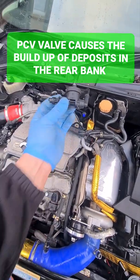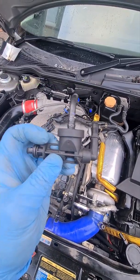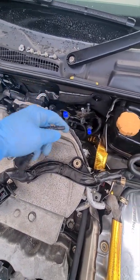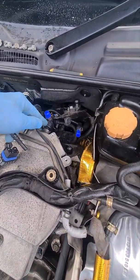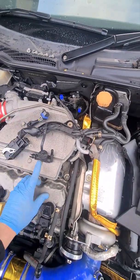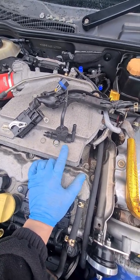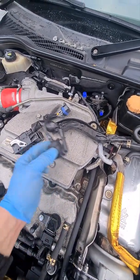The rear bank has a PCV valve which pushes into the rocker cover at the back of the engine — it's a bit hard to see down there. Inside is a little valve mechanism with two small rubbers and diaphragms. This pipe connects onto the vacuum pipe — the long spaghetti one at the back of the engine — and an additional pipe connects onto the inlet manifold with a one-way valve. Under certain driving conditions the valve opens to let the engine breathe, but under boost pressure it won't breathe, so it's not ideal.